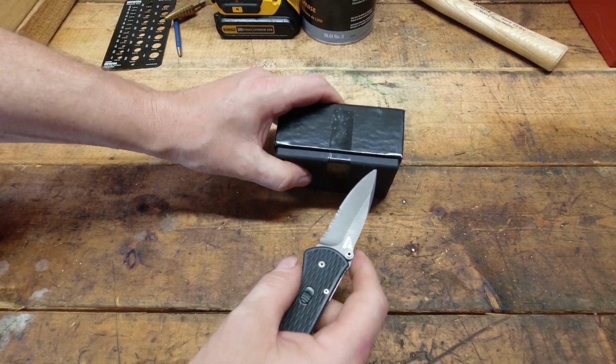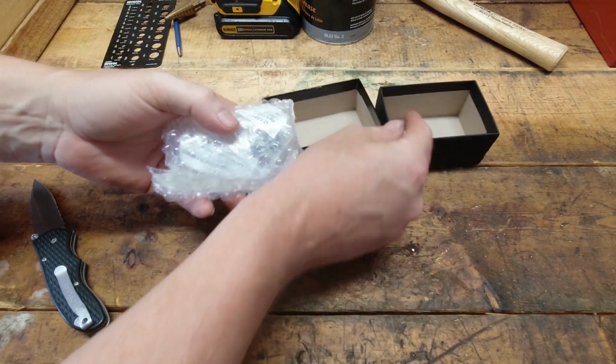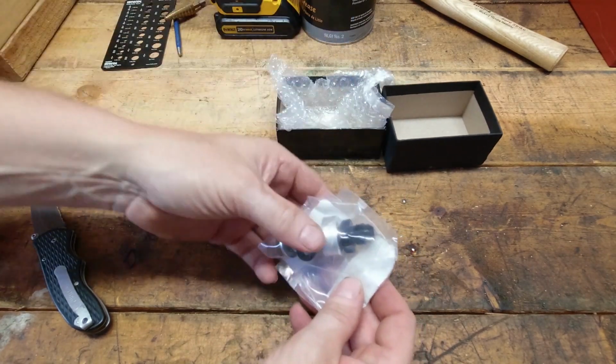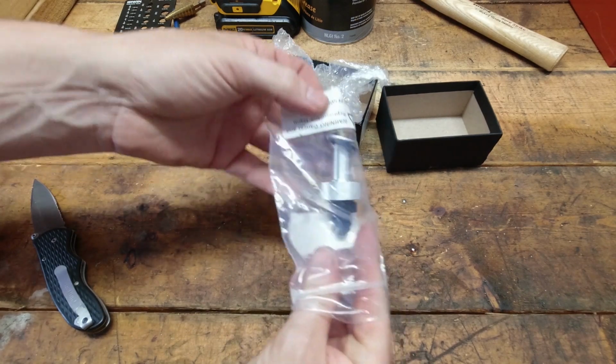So this Fast Return Line kit is pretty simple, but there are a couple little details I'd like to show you on it. This is used in a factory style tank where you don't have an option with an aftermarket in-sump type of tank pump kit like Aeromotive makes that you've seen here on the channel before. This will add a return line to that tank without having to go through any other welding or cutting or whatever. It is a riv-nut style piece. It comes with a -6 ORB style fitting, which we see here.